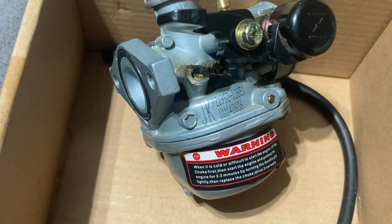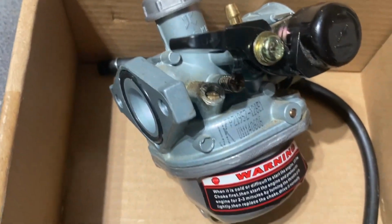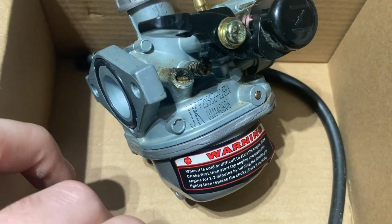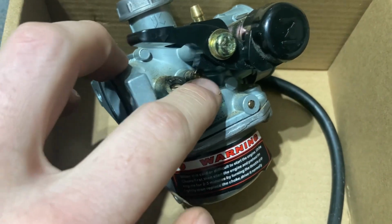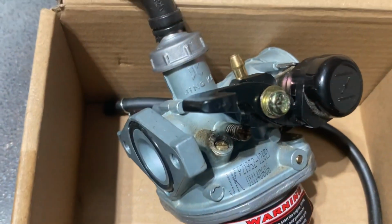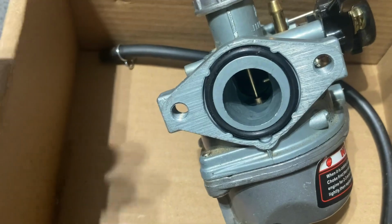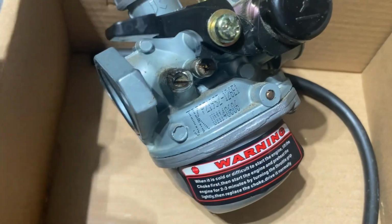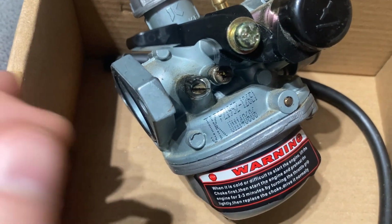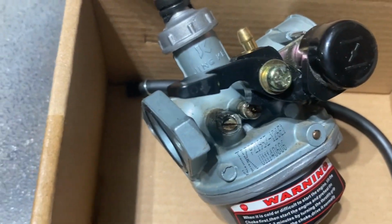And you don't have to know a whole lot to fix this. I know very little about carburetors, and I was still able to fix it. But it's got adjustment screws on it that actually do something. You put it on there. I think most guys say like 2 turns of the screw to start with, or that's about where theirs is. So I started with that and just go one way, turn the bike on, let it idle, turn one way. If it starts stalling out, then go back the other way, half turn or a turn, and keep test riding it in between messing with it.